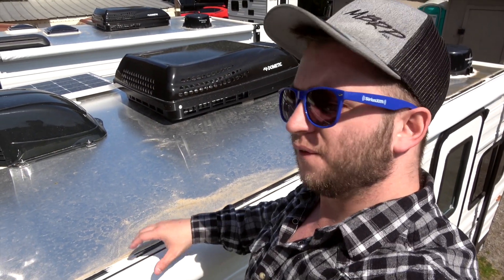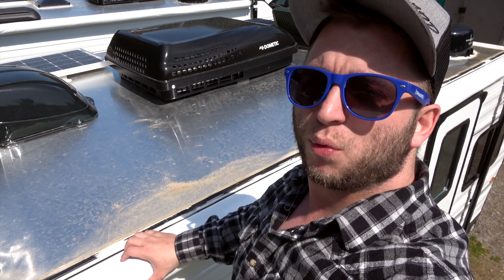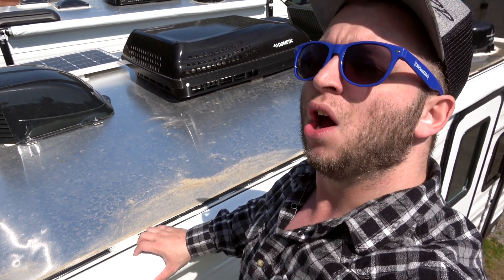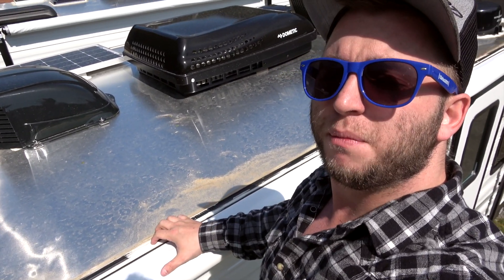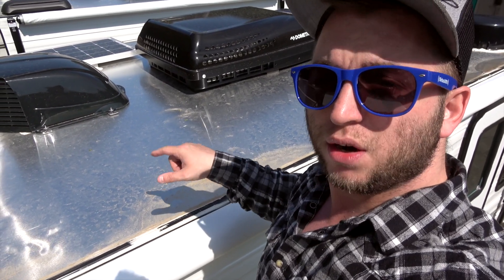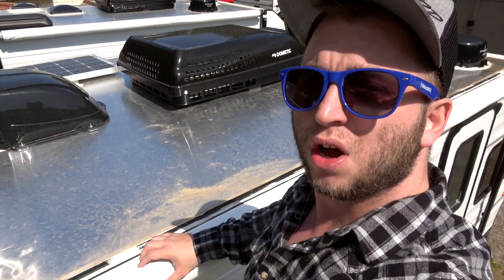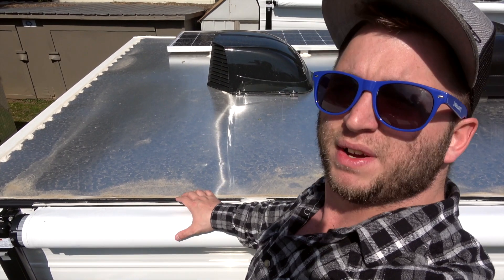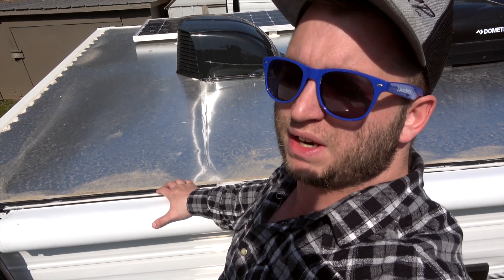Your trailer comes with a 12-year warranty on its vinyl roof. But have you taken an old vinyl jacket and tossed it outside for 12 years? It's going to look horrible. You have to rubber wash and preserve it every year. Have you read the warranty terms? How often do you have to take it back for inspection? How much money do you have to spend on sealants to keep the warranty valid? This is aluminum — one piece, with minimal maintenance you can do yourself. This will last 40 years sitting outside, with no cover, no indoor storage, nothing special required. Sealants need to be touched up every 18–24 months otherwise, you're dropping a bundle of cash at the dealership to scrape and reseal. The silicone needs touching up at about the 12-year mark, and by 20 years you might have half the roof replaced.